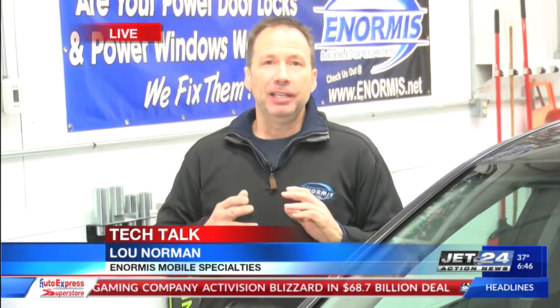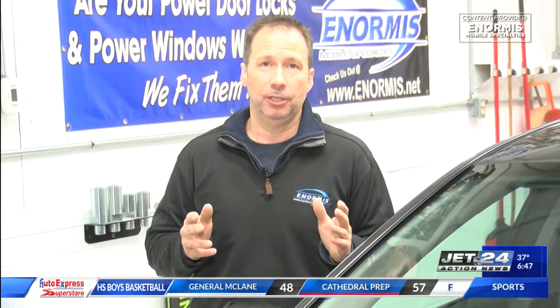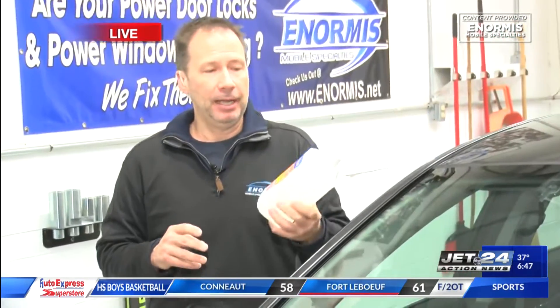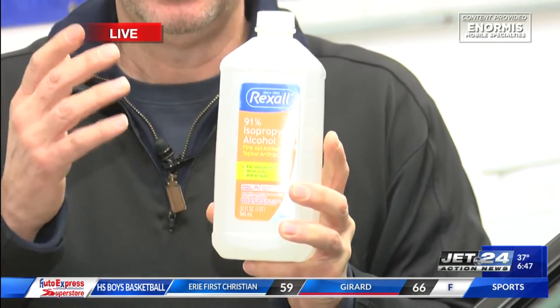Yes, right from your medicine cabinet. Temperatures are going to get really cold coming up. If we do happen to get any ice on your side mirrors or rear windows and you want to remove it, you don't want to damage your car with scraping or with using hot water — you don't ever want to do that. Take some isopropyl alcohol. They make this in 50, 70, and 90% concentrations. The higher the number, the lower the freezing point. What we're going to do is take approximately two parts isopropyl alcohol, one part water, put it in a spray bottle, and in some of the areas your heater can't reach, you can spray it on the glass.